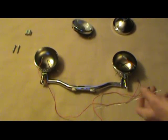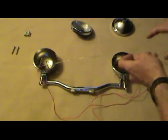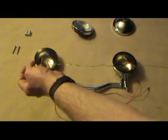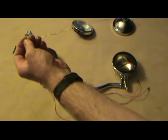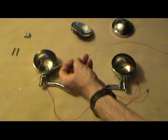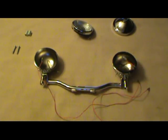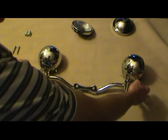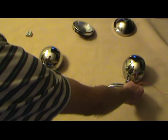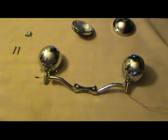To make that easier, I have a piece of mechanic's wire. I'll fish this through the light bar, put a little tape on the end of the wire, and tape it to the mechanic's wire to help pull it through. It's very light wire but pretty solid, so it goes through the light bar fairly easily. I tipped the light bar over, straightened the wire out, and pulling the mechanic's wire, we just pull the electrical wire right through — and you can see how easy that is.